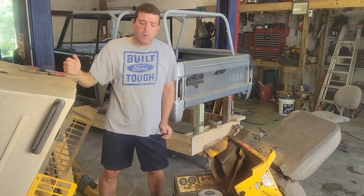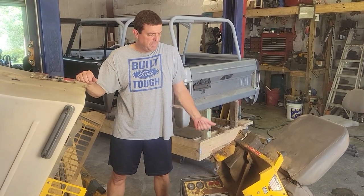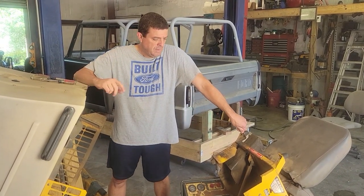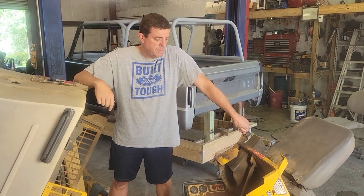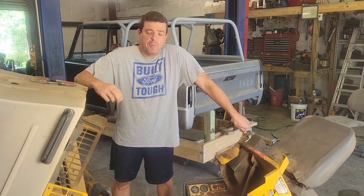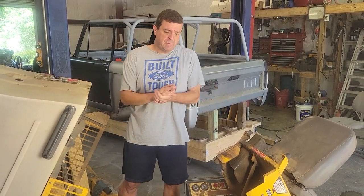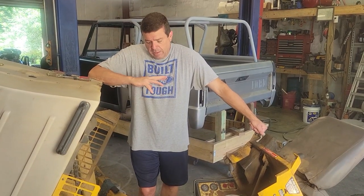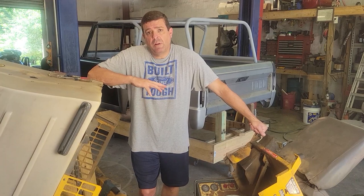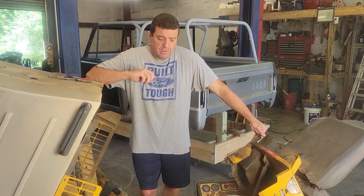But we have a 20 horsepower Kohler and I think it's an MTCHS model Walker, and these are good mowers. They're just kind of a headache to work on because everything is so compact. So like I said, this thing had gas in the oil. He changed the oil in it, and right now it doesn't appear to have any gas in the oil. But they did say it was stumbling, so we're going to look into that.